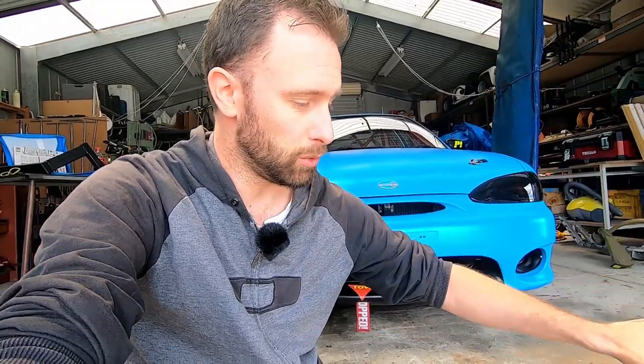It's only an Excel with tiny brakes, but that's actually the problem — bigger brakes dissipate heat. You've got a big caliper and big disc so you dissipate the heat a lot quicker. This car has a tiny little caliper and tiny little disc so everything gets really hot. Which is why we've got our great little brake ducts available now — please order them! So hopefully all this will sort it out.